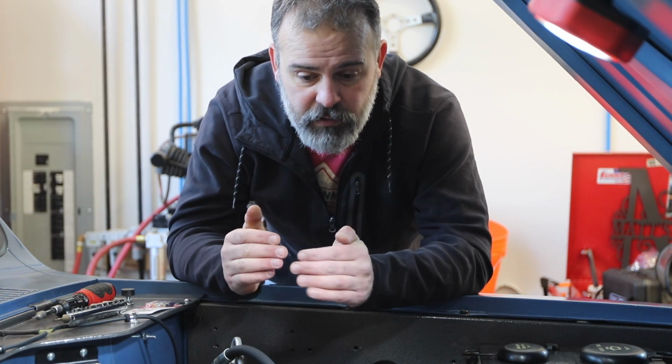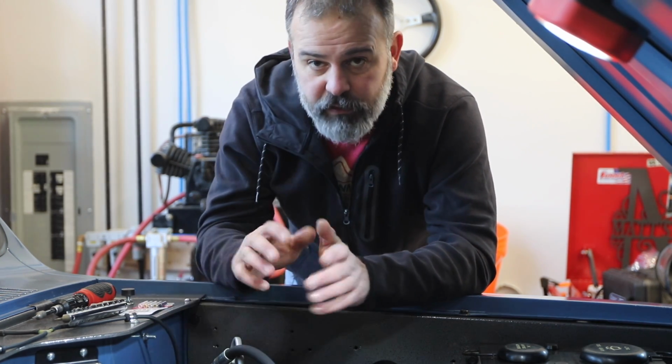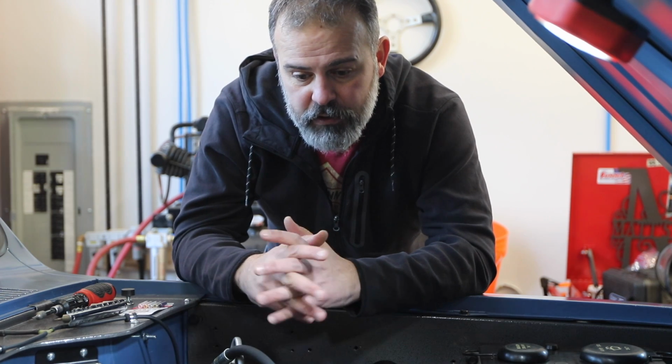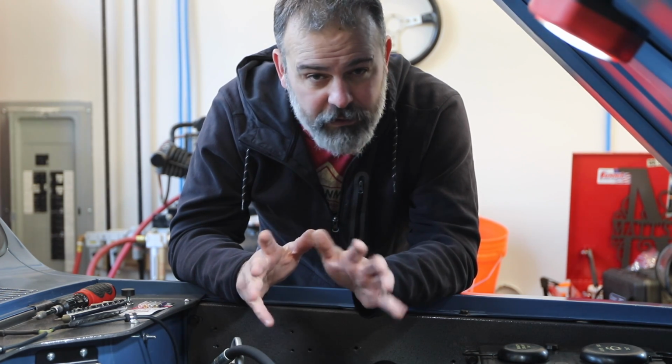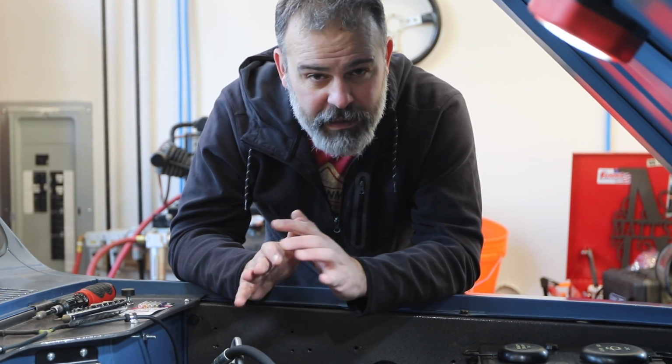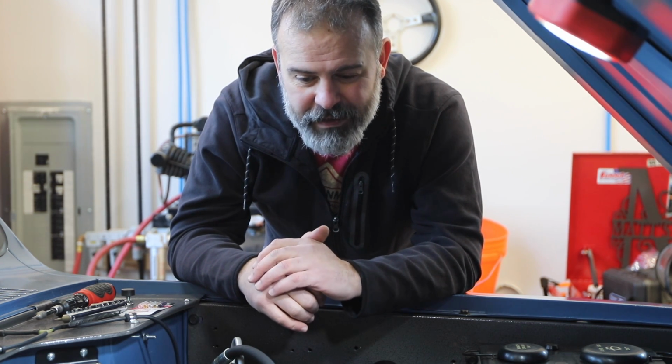Why is it 7 when you normally run 18 inches of mercury for a healthy engine? It's divided by 2, right? So each side gets half of that vacuum. So 7 or an 8 is the highest. So 7 or 8, I think, is what this heavy truck with a bigger motor needs. I think that 5 inches of mercury is really set up for like the more 5.0 liter, 300, 289 size engines. I think for a 350 with the Vortec heads and high compression, it needs a little more spring.